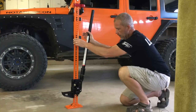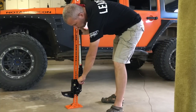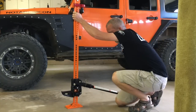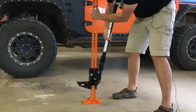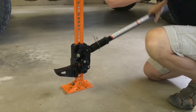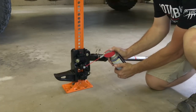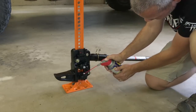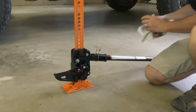It's got a little retainer spring so that you can lock it up. When you're ready to go down, slap the pin down and if there's weight on it, it will jack down. Push the pin down with no weight on it and it'll slide right down — that puts it in free movement mode. Maintenance with the High Lift jack is pretty important because if those pins don't move in and out easily, you won't be able to get it to move up or down. I actually had a little trouble just now getting it to go from the up position to down because I just had it powder-coated and there was no lubrication, so those pins weren't moving in and out well.